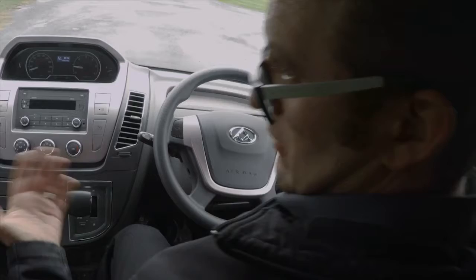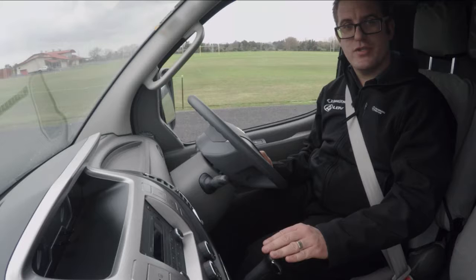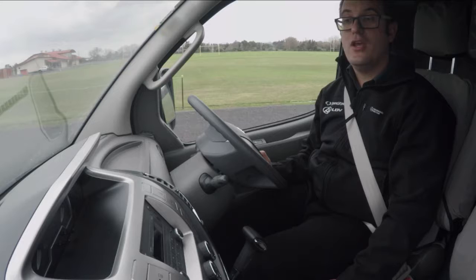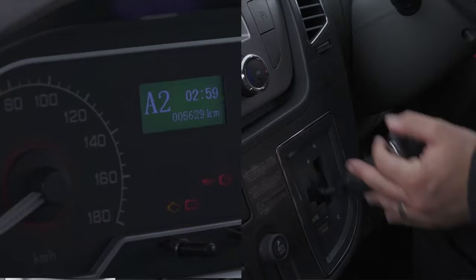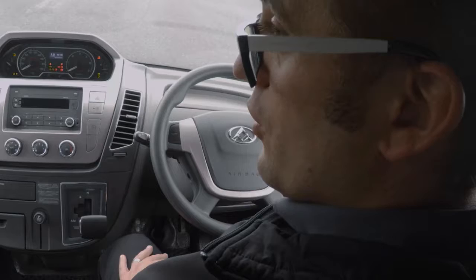The last thing you need to know is when exiting the vehicle, please always ensure you pull the handbrake fully on. There is no park mode on this transmission, so you can leave the transmission in the neutral position. However, if you want to park on a very steep hill and you're concerned about the handbrake holding the vehicle and its load, you can leave the vehicle in first, second, or reverse gear. Simply leave the vehicle in A, A1, A2, or reverse, turn the key off and exit. When you return, turn the vehicle back on and shift back into neutral to start the engine.